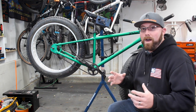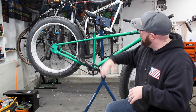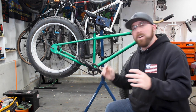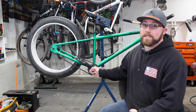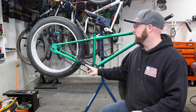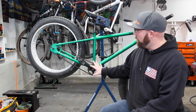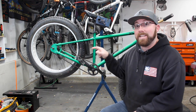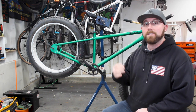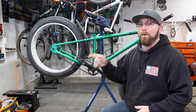Once the wheels and tires were done, we worked on the individual components. We swapped out the crankset for an inexpensive square taper aluminum crankset with a 32-tooth chain ring, and went with some basic flat pedals — similar to a Race Face Chester but a little wider so winter boots fit perfectly. We also regeared the back of the bike, changing from a 16 or 18 tooth cog to a 22-tooth cog for super low gearing so we can pedal comfortably through the snow.